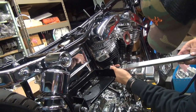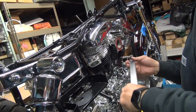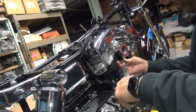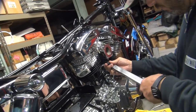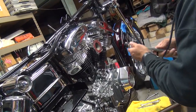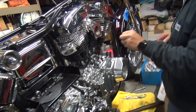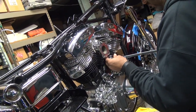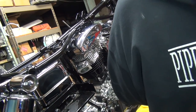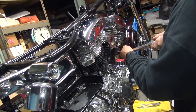No, tighten them all, just go ahead and torque it. Torque it. I'm waiting for you. There you go. They're already roughed in, just like you had on the other side until you do the final. This is only 30 foot-pounds. We're not even close yet. You gotta over double this. You notice how it just barely clears that intake manifold? Yeah. Do the front one. You're already set up for the front one. You already had the angle set to do that one when you're back over here. You're getting good now. Next thing you do is look at the clock. Look at them second hands going like crazy.